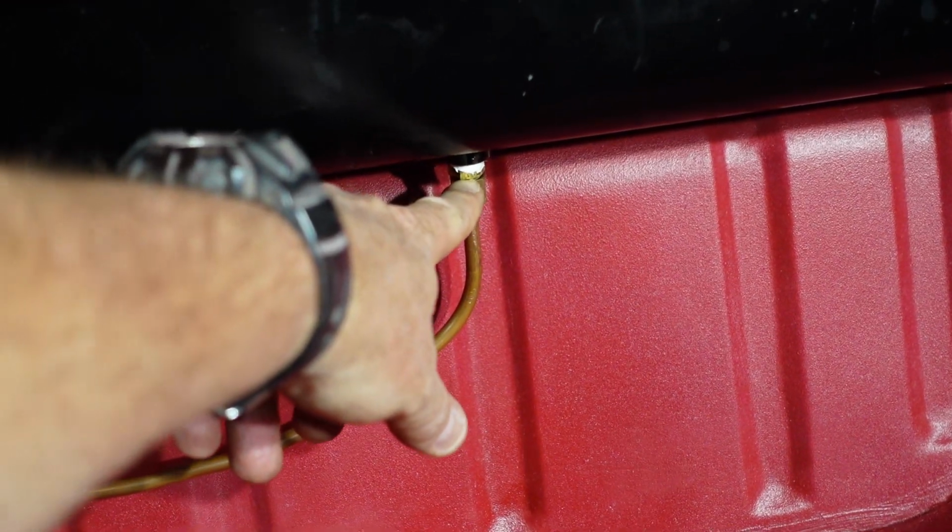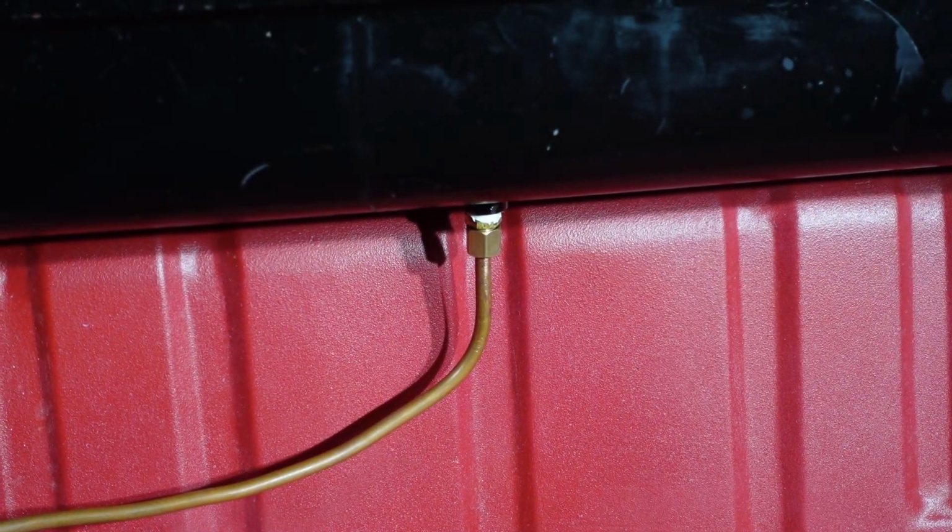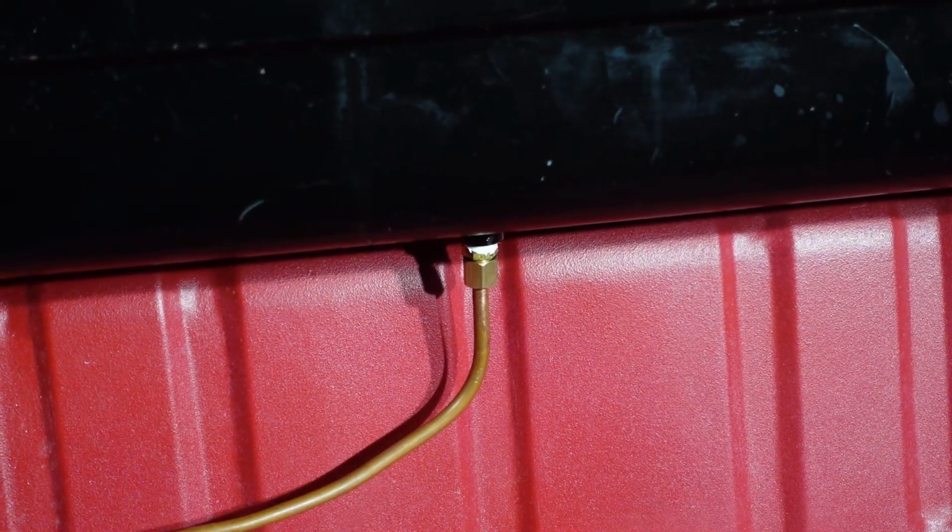So the gas tank originally had a male-to-male union here, and it went from the smaller threading that was in this nut to the larger threading into the tank, and one side of it would take an olive nut. So essentially all I did is go out to my local True Value, buy an olive nut and this little cap screw here, and put it in. Gas is back in it. It's all filled up. No leaks, so that's good.